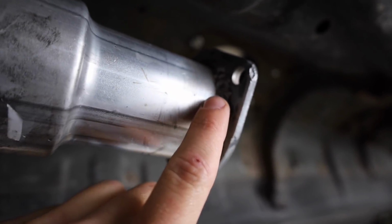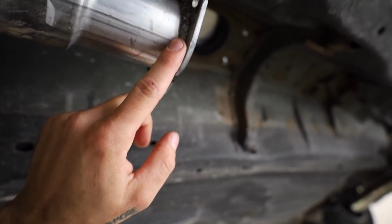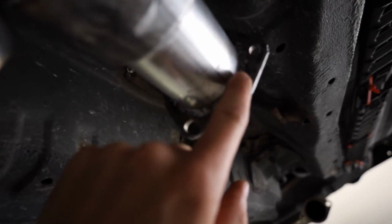As I was welding, I kept looking at Chris saying like, dude, my welds are getting worse and worse today. But what's happening was my gas was probably running out and out and out to the point where I had none. But I think what I'm gonna do, just so I never have to see it, is I'm just gonna thickly bead over top of all that, just because I don't even trust that it's like, there's so many holes. It's like popcorn right here.